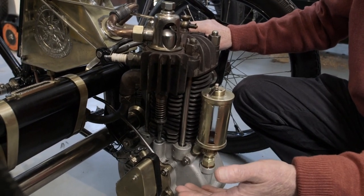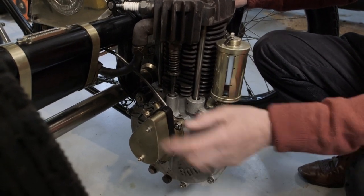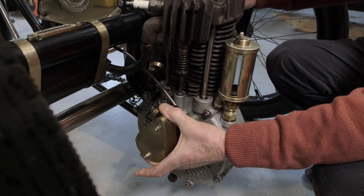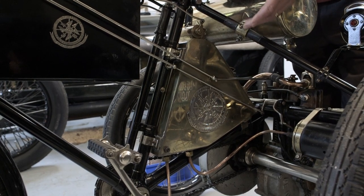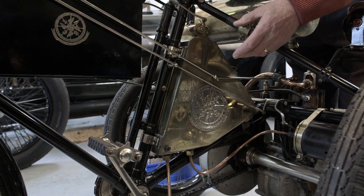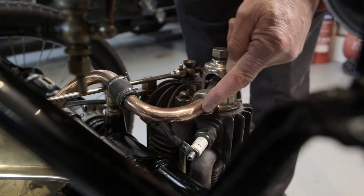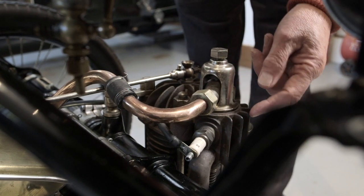So there is no water involved. Aluminium crankcase — early use of aluminium, a very lightweight material. The ignition system has advance and retard, controlled by a lever up by the handlebars, so you can adjust it very easily. This brass container here is actually a carburetor — it's called a surface carburetor because it uses the vapour from a volatile liquid, usually hexane, and sucks that vapour in through the inlet, where the explosion happens at the top of the engine, at the spark plug.